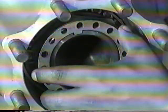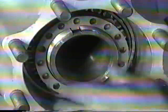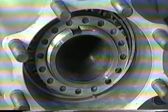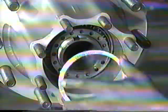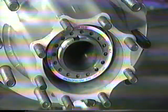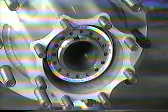Install the dowel type lock washer onto the axle spindle aligning the tab with the keyway. If the washer does not align with the dowel pin on the inner nut, remove the washer, turn it over, and reinstall. If after this the washer still doesn't align with the dowel pin, tighten the inner nut just enough for alignment. Never tighten the nut more than half the distance between the holes. You should never back off the spindle nut to align the dowel pin with the dowel washer. For drive and steer axles, install the identification ring onto the spindle over the outside diameter of the dowel type lock washer with the anti-rotation bosses inboard and over the flats of the inner spindle nut.